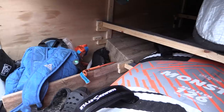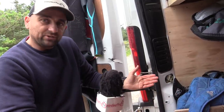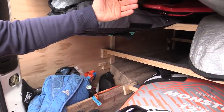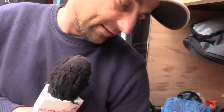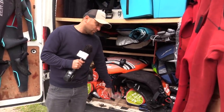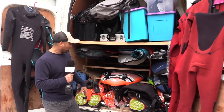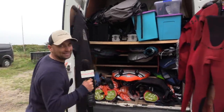Using vinyl I've basically created a bathtub in the garage — it's all waterproofed. It goes up all the way along the sides to above the wheel arches on both sides, and up the front as well, so water cannot get down to the bottom of the van. It all runs to the back, where I've rolled the vinyl over the wood and glued it to the metal, so water doesn't go back under the wood. Definitely super important. Obviously there's a lot that still needs to change in the garage area.